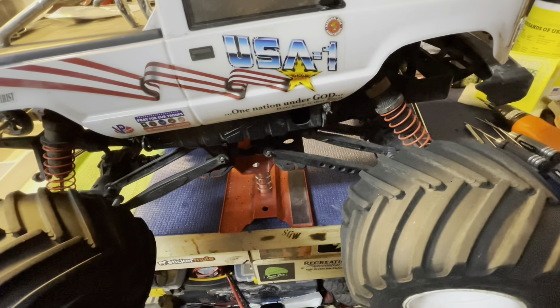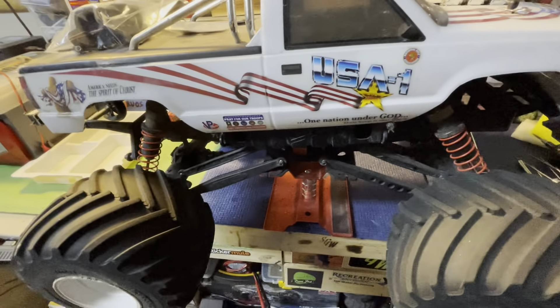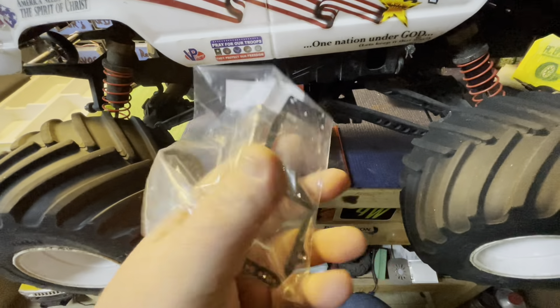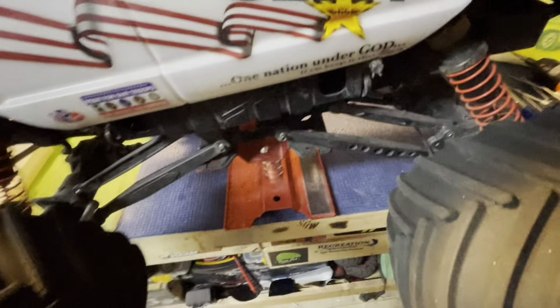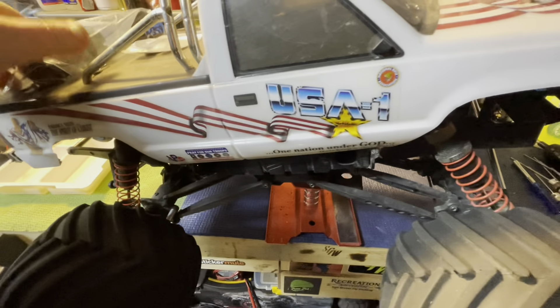To cure this problem I was going to use this steering mount from a 1/8th scale Kyosho buggy. You cut the ear off on this side and mount it, giving you your servo mount basically. There's only one video out there on YouTube showing it, but basically it uses the stock piece — you cut the ear off of that mount, screw the two together, and that's your servo mount.